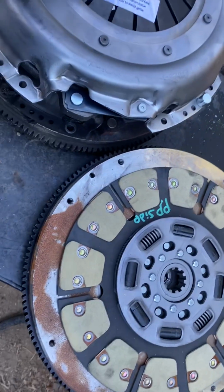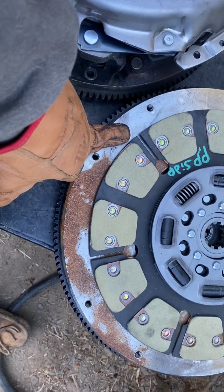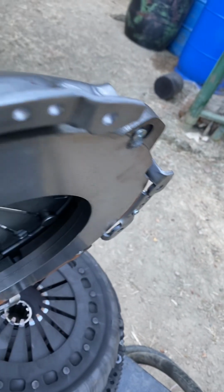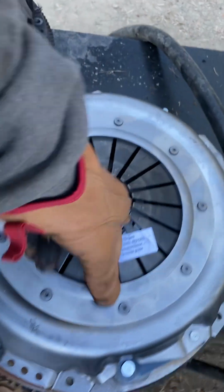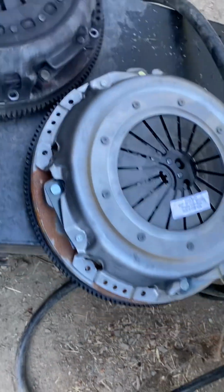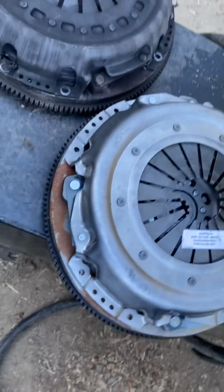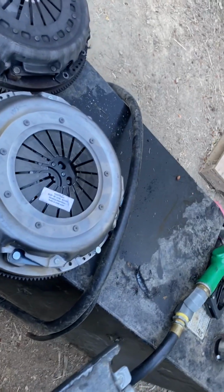Now, once again, these pads drive directly onto this, and then directly onto this. So once you release your clutch, those pieces squish together, and you're looking at pretty much a mechanical connection. It does have some slippage. It's not quite the same as a direct, like, right to the shaft, but pretty good, pretty mechanical.